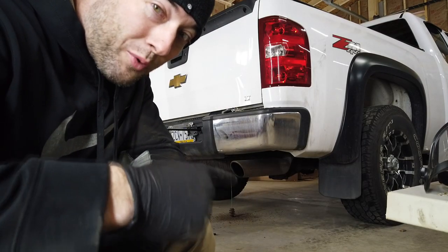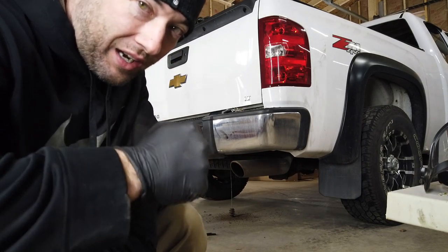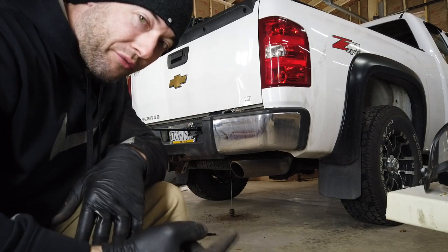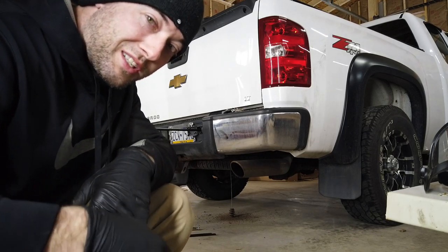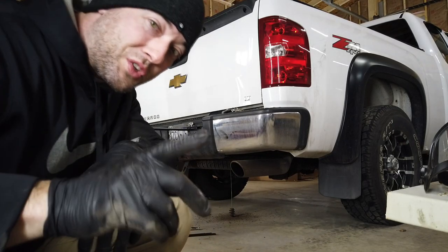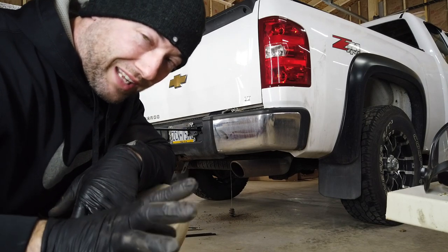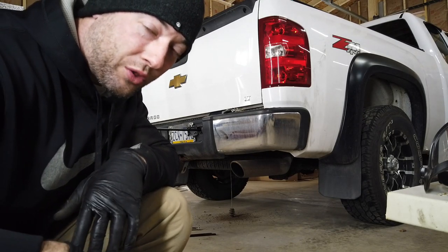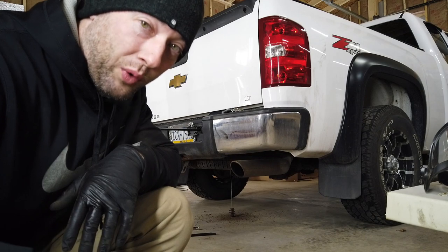Alright, so what I've got going on is my cable came down but my secondary release is stuck. I need to get a screwdriver up in there and see if I can get it to unlatch. GM put a secondary latch on there so if the cable snaps your tire doesn't drop down out. But that rusts and then it wants to stick up in there. So the cable is free and it comes down, the tire does not come down. GM also changed the spare tire to an aluminum rim instead of a steel rim, so it's actually pretty nice still.